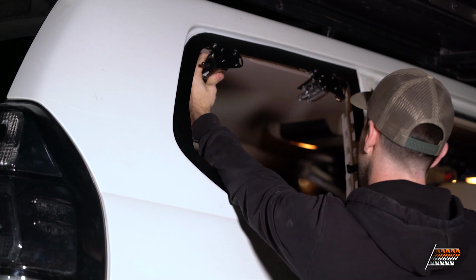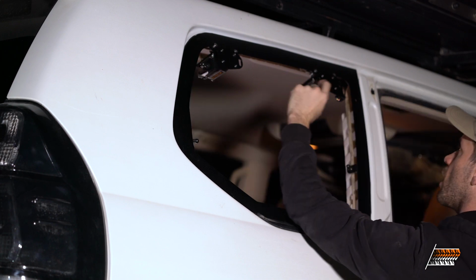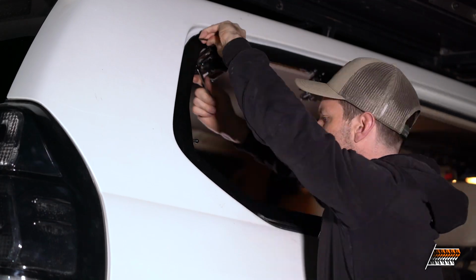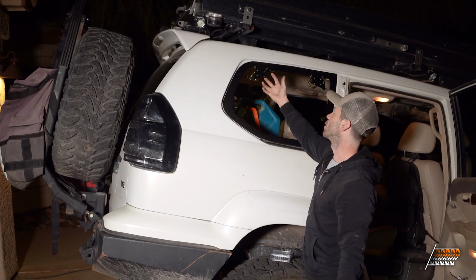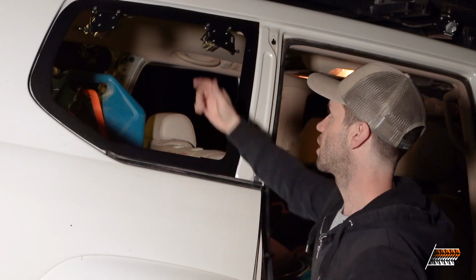It's important that you keep it all loose so that you don't have many problems. So now we can go ahead and tighten these. You don't want to crank down on them, you just want them nice and firm. I think that's because when you're tightening it down, there's sheet metal up here that you're clamping against, but if you tighten this down, it'll sandwich it like this, and it'll want to peel the gasket from the frame away. So you just want it snug-ish, enough so that it doesn't move and it helps clamp.